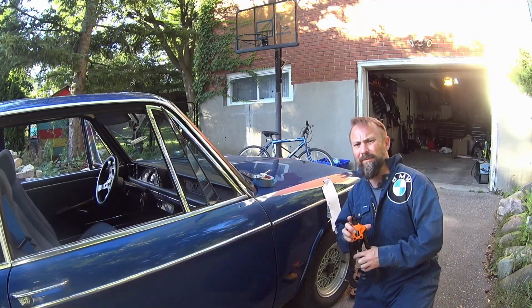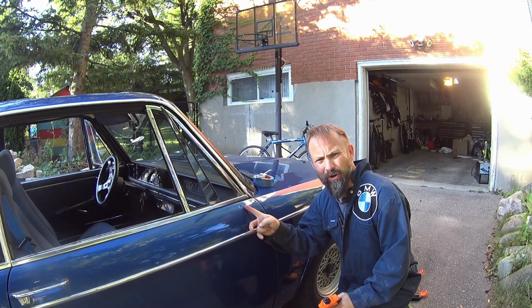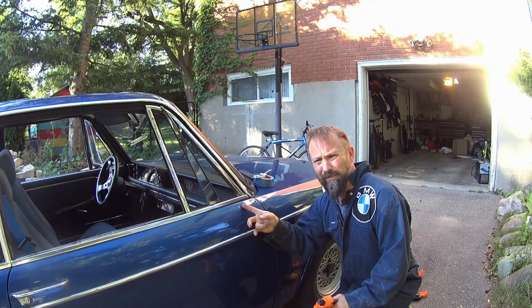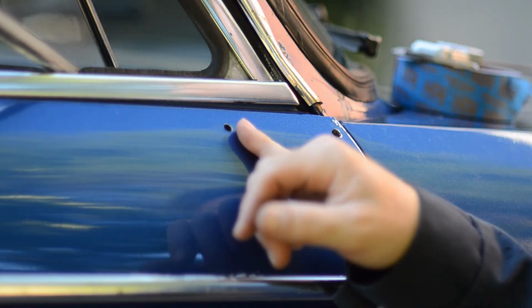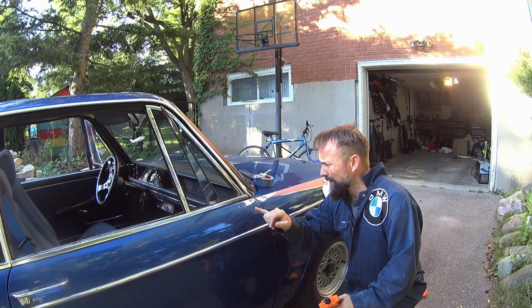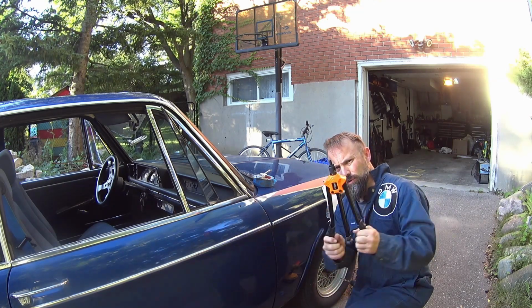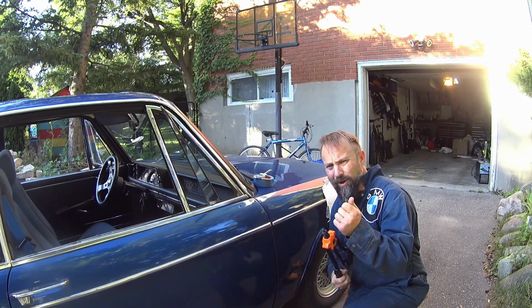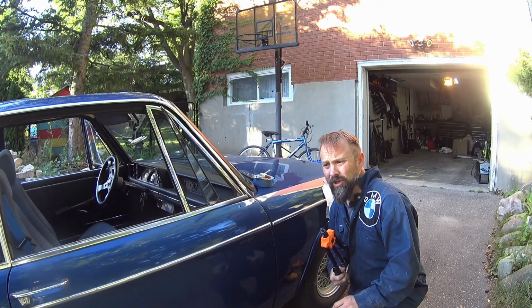Oh, all right, so I've made an error. The screw that goes in here, the machine screw, is an M4 by 0.7. And I have the riv nut for that. I bought them. This one again is a through nut, but the riv nut kit that I bought doesn't come with an M4. The smallest it has is a 10-24 and an M5.